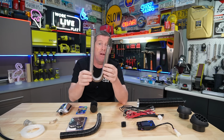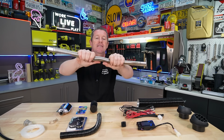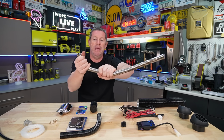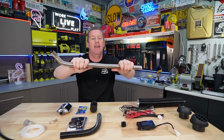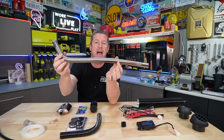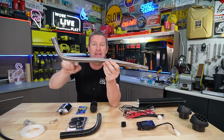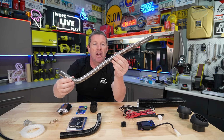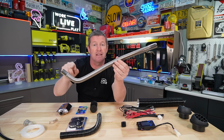The one thing to bear in mind with the exhaust runs, if I actually straighten this out and put a little bend where it's going to come out from the bottom of the Caravan itself, is that you want to get rid of any dips and make it fall down to the muffler. So you don't want to have a dip in this area where it directly comes down outside of the heater, and you certainly don't want it running uphill so you end up with condensation collecting in this lower point.